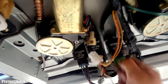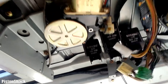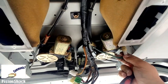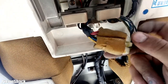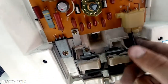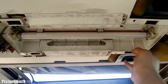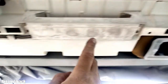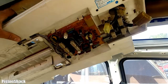As you can see, there's a wiring harness and relay switches — disconnect everything connected to the sunshade assembly. Start disconnecting them one by one; there's a simple locking tab, just press it in and pull the connector out. There are a bunch more connectors — undo all of them because the entire assembly needs to come down. Now we're removing the lamp assembly; there are Phillips screws holding that bracket to the roof.